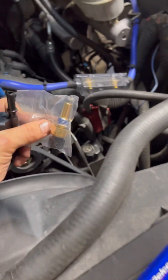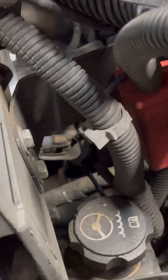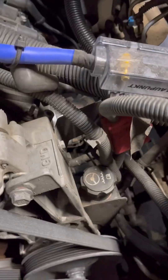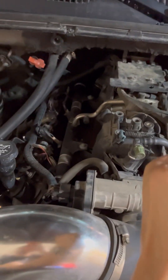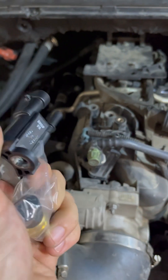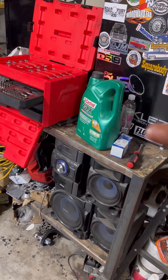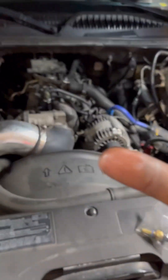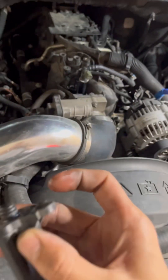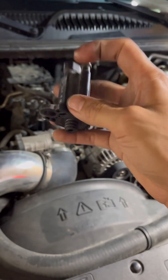I'm going to put an engine coolant temperature gauge on next — it's located down there, you can see the switch coming off of it, so stay tuned for that. But for the purge valve — if you have some extra engine oil, scrub it on your finger, and there's an o-ring on the bottom of the purge valve — right here — scrub it on that o-ring.